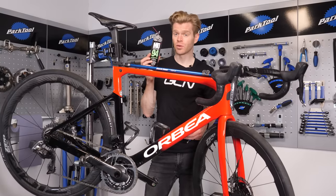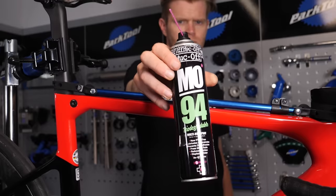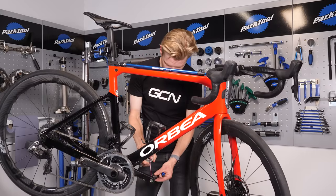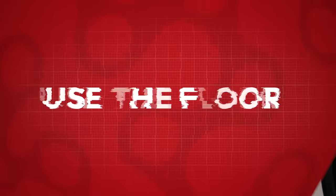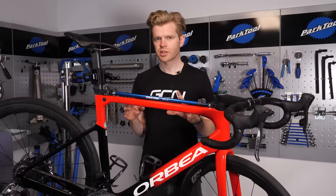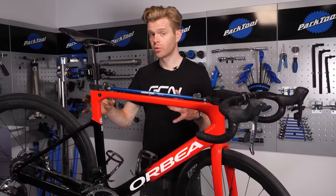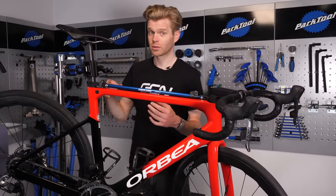Something like this MO94 is great. A lot of these kind of sprays contain PTFE, but one of the things I like about this one is it's biodegradable — it doesn't contain PTFE, much better for the environment. A little bit of that on there often helps proceedings. I'm also going to suggest that you don't try and operate on your bike removing pedals with it in a stand, but do it with the bike on the ground, because you can actually apply more force, as I will show you.